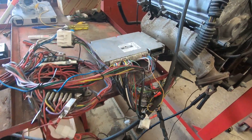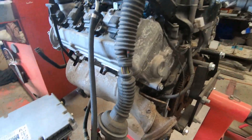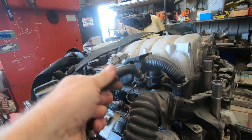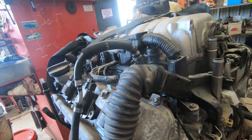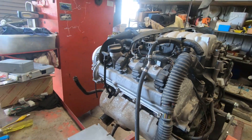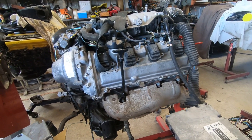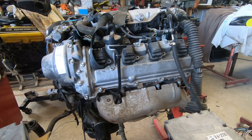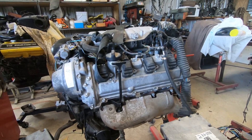The problem I've been facing is I've got this engine all set up ready to run and test. There's only one line — it's a returnless system with only one fuel line going into the engine, and you don't want to go changing that because that's the way the engine's set up to run. The ECU has been calibrated to run returnless. Guys that go put a fuel pressure regulator on it, which changes the pressure differential across the injectors, are never going to run quite as good as they do with the proper fuel pressure setup and the returnless setup.